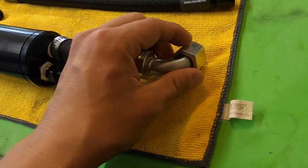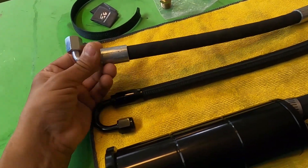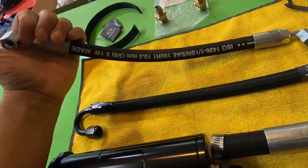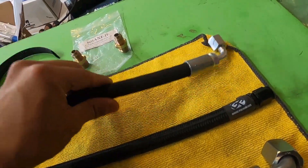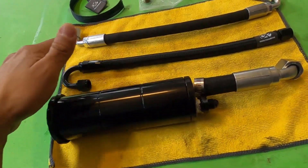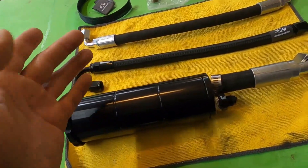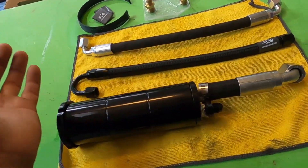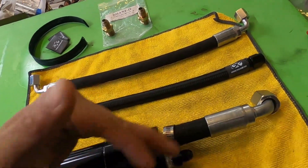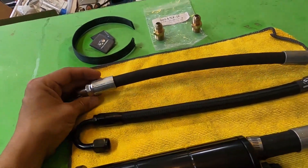So we went ahead and got that dash-10 adapter — I'll show you guys where that's going to live for that dash-10 line. We also picked up this pressure line. I always recommend doing a power steering pressure line as a crimp style, just like this one here. The tricky thing is when you start plumbing your power steering, you really need a few fittings lying around. They don't have to be the exact ones — you can tape them together and put a line in between to get an idea of what you need.